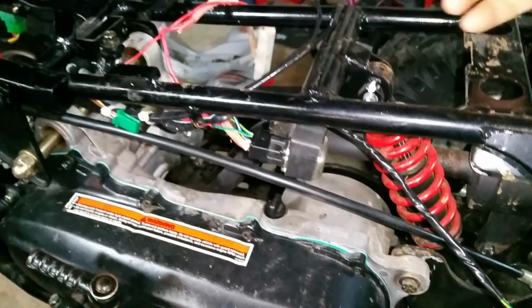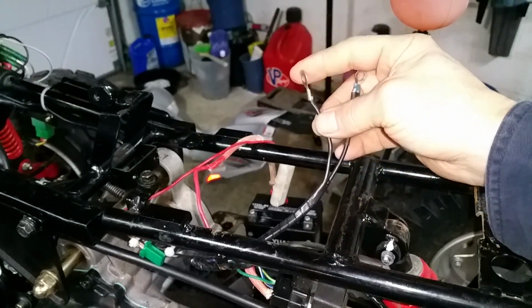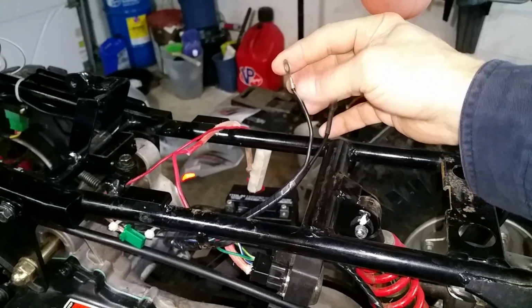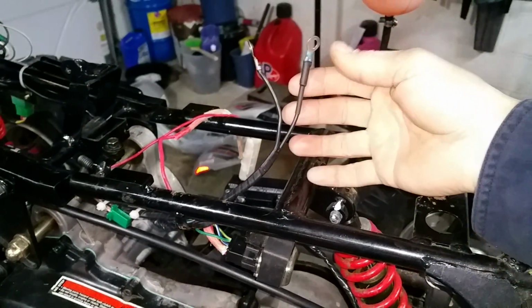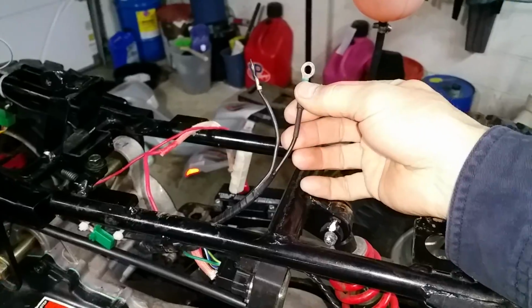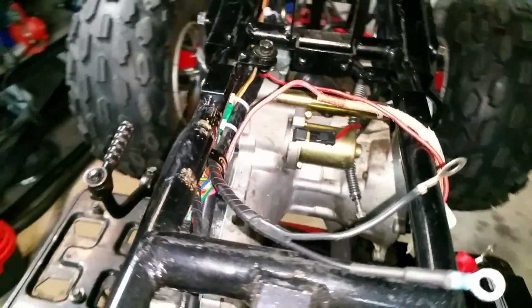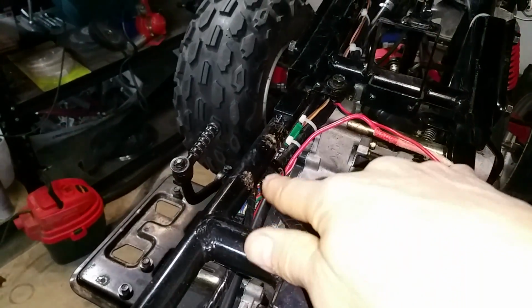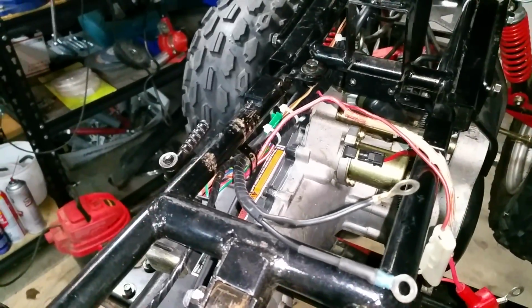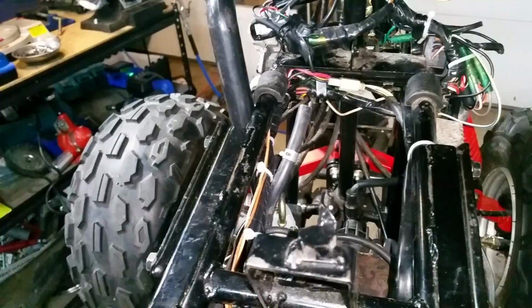Cleaned up your wiring coming back through here. Also, we went ahead and reran a ground wire, a negative wire from your headlight because it was kind of mismatched, and also did some heat shrink and a proper connector, so it should be really good and durable. Cleaned up the whole negative loom going up to the front there. Some zip tying, just to clean everything up.